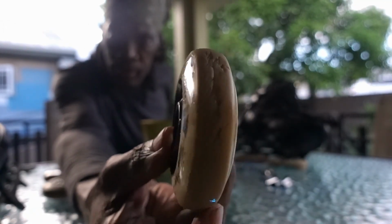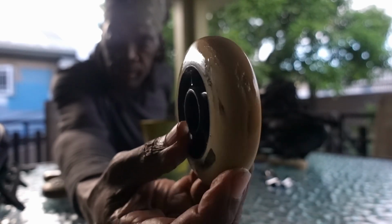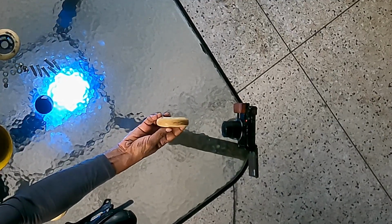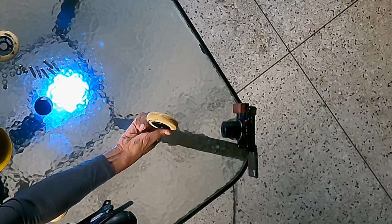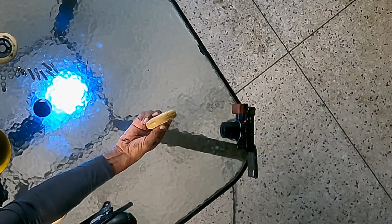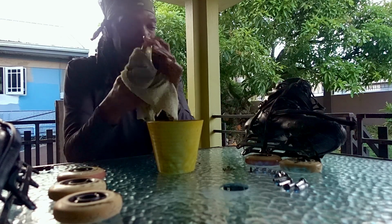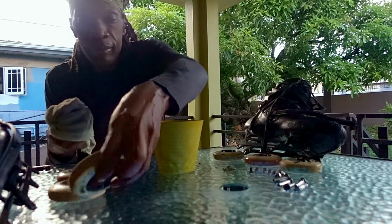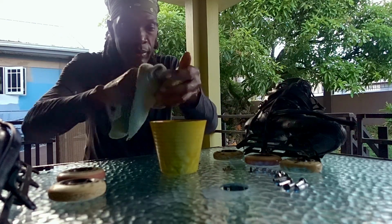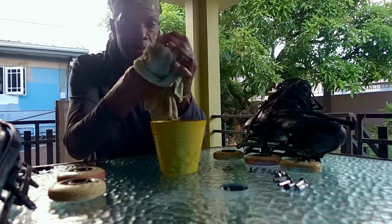Pitting, small localized cuts, cracks or holes on the wheel will indicate they will need to be replaced soon. Check the profiles for flat diagonal surfaces and unusual wear. Taking note of wear patterns on your wheels and figuring out why, based on their position, gives valuable insights about how well you manage your braking, stopping and sliding techniques for maximum wheel life.